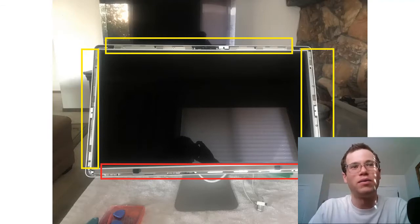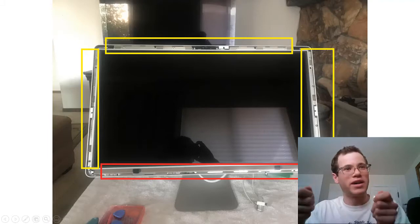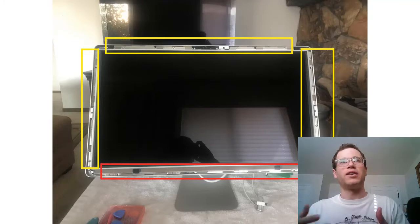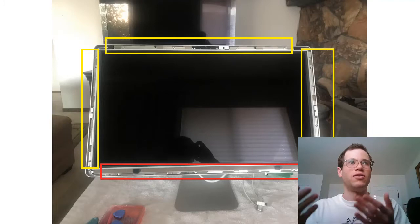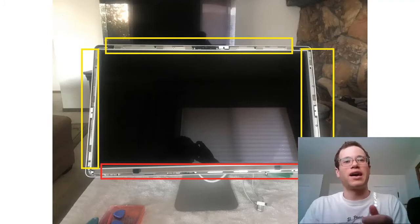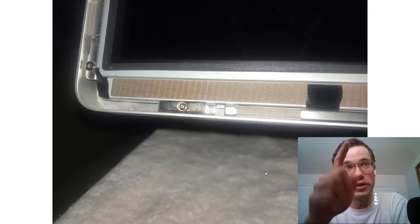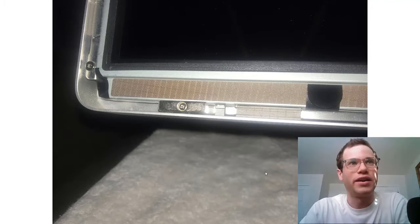Also make note that on the bottom of this display you can see two black pull-out tabs. Those are how you're going to pull the display up and out of the housing once you've removed the screws. You're not going to pull the display back the same way you pulled the glass off — you pull the display up from these black tabs. Here's a close-up showing the Phillips screws and the black tab on the right, and there's a second one on the left.